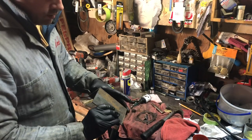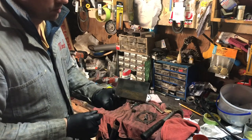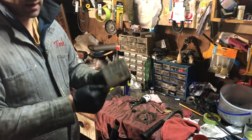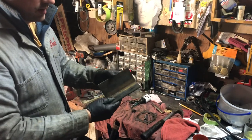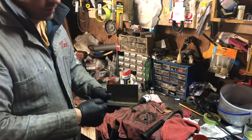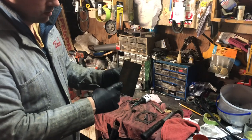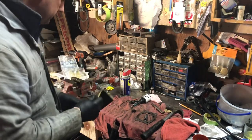Okay, we are making a tool to extract that wheel bearing off of the rear axle, one of the rear axles. And to do that, you have to cut a big hole right here in the center of a piece of steel and a couple of holes on either side. Or you can buy this plate. Mitsubishi used to make a plate that you could buy, and I'll show you in the next video how this works, extracting that bearing. But the plate's like $100. I found a couple of them online, and it was $100. There's no way I'm spending that for something I can make. So what we're gonna do is hole punch about an inch and 5/8, inch and 3/4 hole right in the center of this, a couple of holes on either side, and then I'll show you how we use this to extract a bearing.